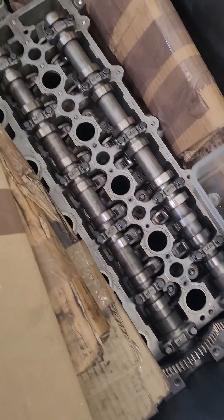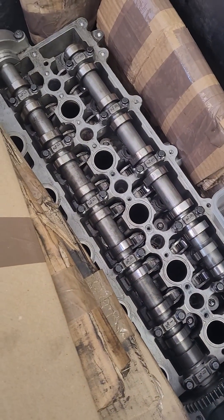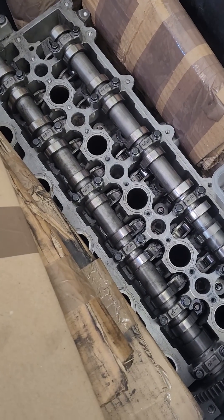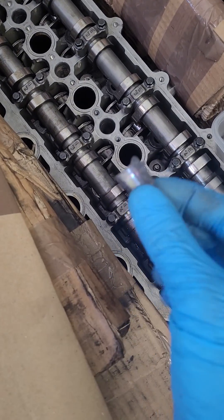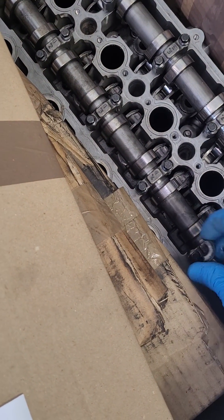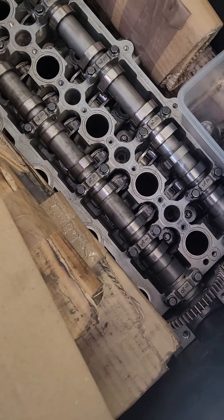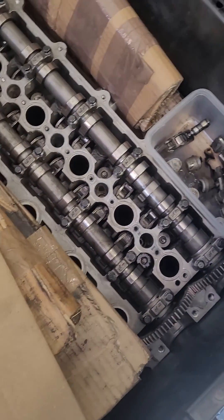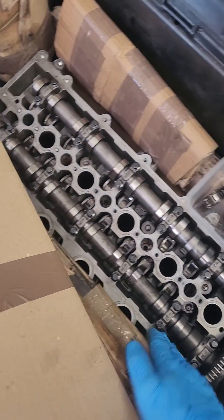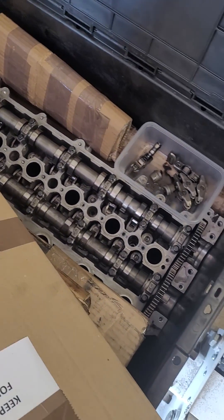This is my original head. For whatever reason it might have happened to yours, but the timing will slip and then you find that the pistons hit the valves. The valves have got this sort of fixing — casting, should I say — which sits underneath the rockers and they all smash off. You end up with a cylinder head full of broken parts that rattle around and it destroys the actual casting of the head, so you've got to send that back or get a replacement at least.